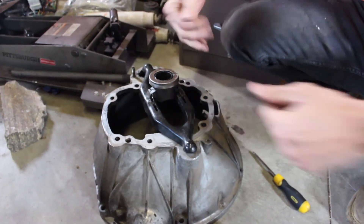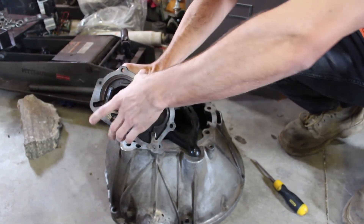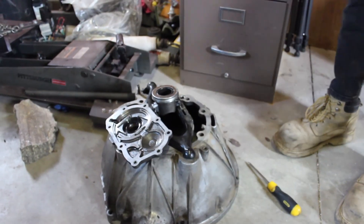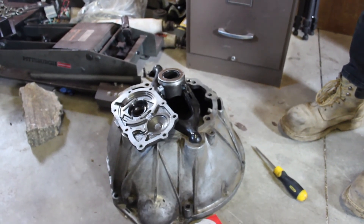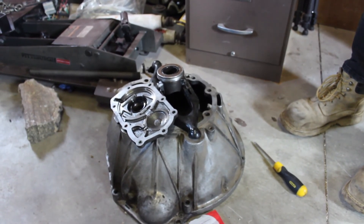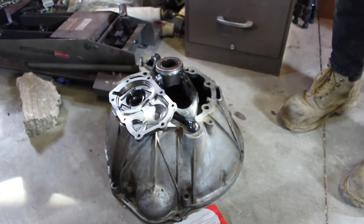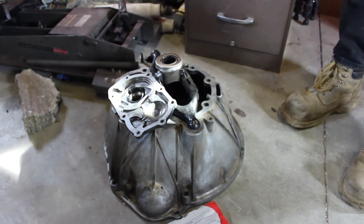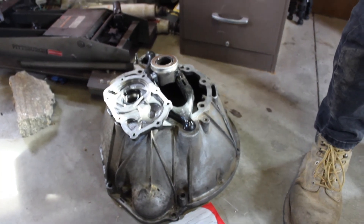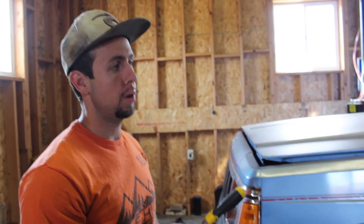So those are the pieces you need. And of course you're gonna have to get a new external slave — you're gonna need the master cylinder and slave cylinder. That's a one pre-filled unit you can get from an auto parts store. While I'm in there, I'm gonna replace the clutch because it makes sense, and I'm going to replace the pilot bearing as well in the back of the engine block. This will apply really if you're taking a transmission out, switching a clutch, or anything — it's gonna be the same steps.